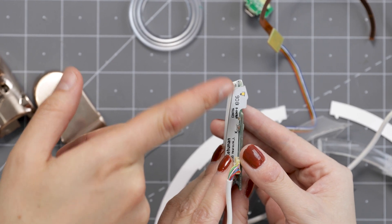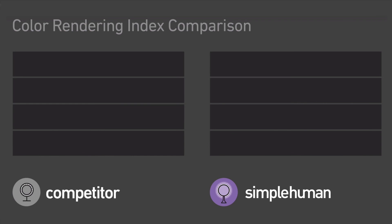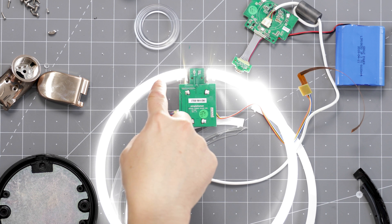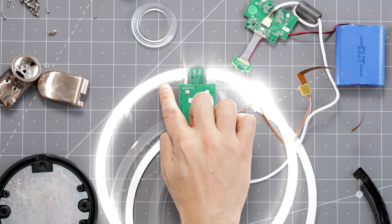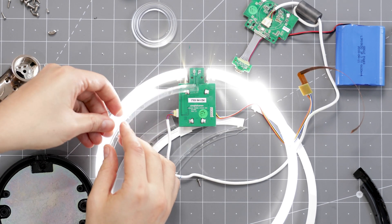These LEDs are incredible — they're half the size of a grain of rice. There are just two of them and they create that entire illuminated ring. These are custom designed with a specific CRI, the color rendering index. When dealing with the color of light, that is what we're trying to control, and to recreate natural daylight on your skin we want that to be really well controlled. These super bright LEDs inject light into a large light pipe — it's a half full ring. They reflect light off tiny little dots in the back; otherwise the light stays inside the ring with very minimal cast. In front it's glowing bright, and they have a really nice diffuser. The effect is like a perfect ring of light.